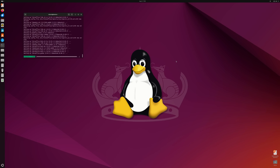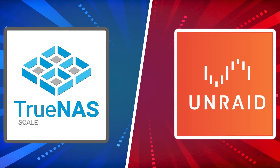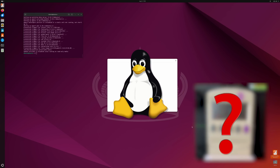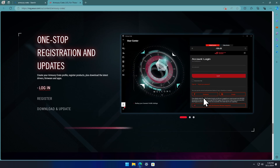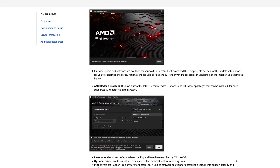As far as operating system selection goes, you have quite a few options — Linux server, Linux desktop, or even a NAS operating system. For this build, I'm going with Windows to see if I can tune it to be both efficient and performant. I also tested the power settings with Linux, so I'll have some comparison later on. Once you have Windows installed, you'll want to be sure you have the latest drivers. Your motherboard manufacturer should have them, but the Intel Driver Assistant and AMD Auto Detect tools might have more current drivers for your system.